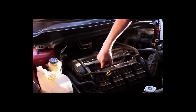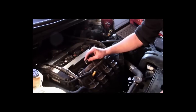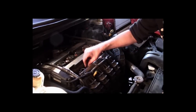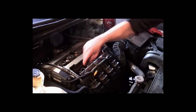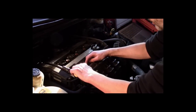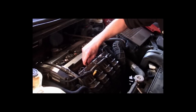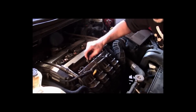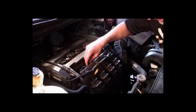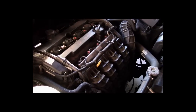Let's try doing that. Let's try disconnecting the fuel injector real quick. Okay, again, disconnecting the fuel injector. You hear that? Yeah. Okay, so Juanita agrees. She heard a change when I did the fuel injector. I heard that same change when I did the coil. Let's do that again. Yeah. Plug it in.